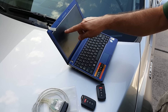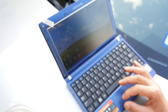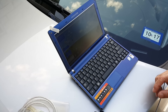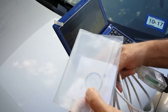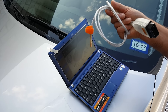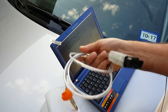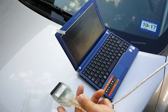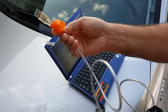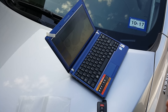To do this, you need a software called TechStream. I'm going to launch it right now. This software must be installed on Windows XP — it will not work on any other Windows version or Mac. You also need this cable that came with the software. One side goes to the OBD2 port on the car and the other end is USB that connects to the laptop.